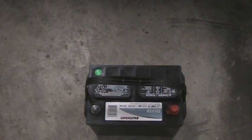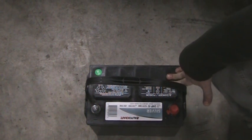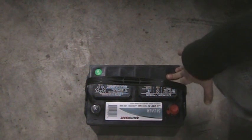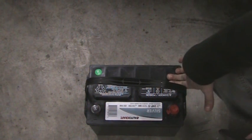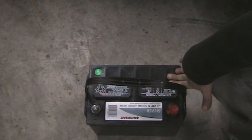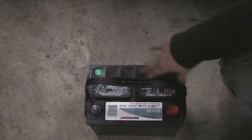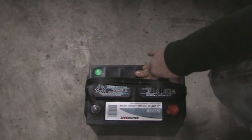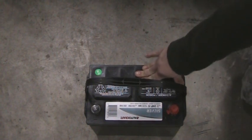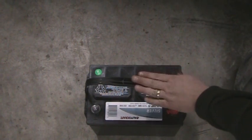Here's the new battery — purchased it from Advance Auto. The old battery I had also purchased from Advance. The battery comes with a two-year no-money-required replacement and a 72-month prorated warranty. I didn't realize I had purchased the old one there, but they looked it up and I got a new battery for $37 instead of $89 — that was nice. They did a test there and it had only about 140 cold cranking amps.